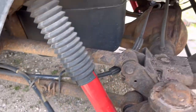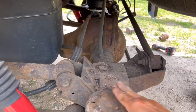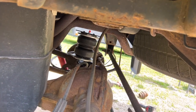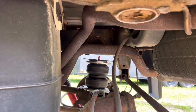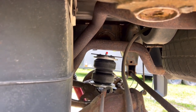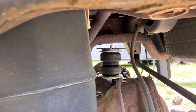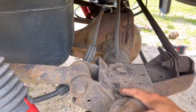What we did on this side is we jacked it up, lifted it, and took out our heavy duty spring — that's our tough spring sitting right over here. Right up top there's a bumper stop that looks like this, so we took a Sawzall and just cut it straight off. We dropped it out of the way and we're going to come right here and grind it flat. There's a little bit left over below, so we'll grind that down flat and drill out our bolts.